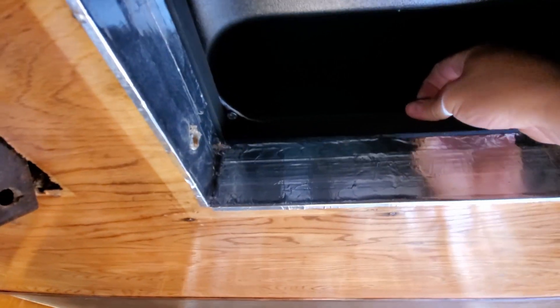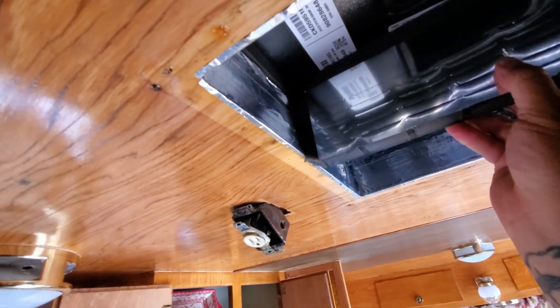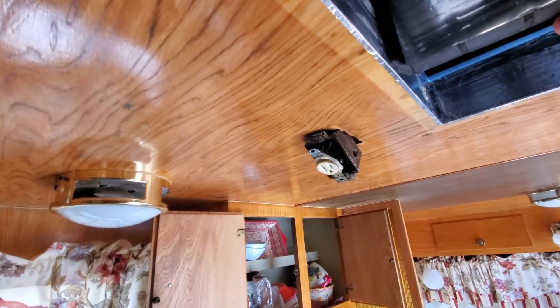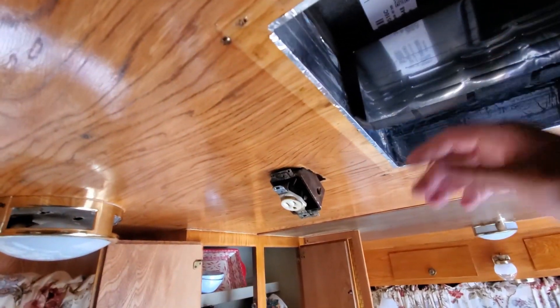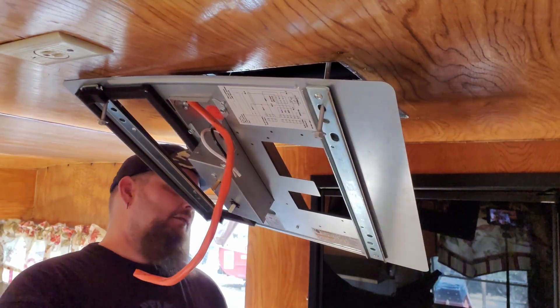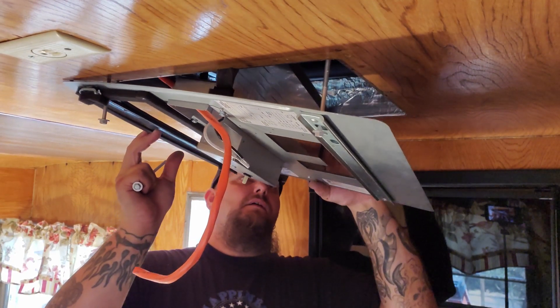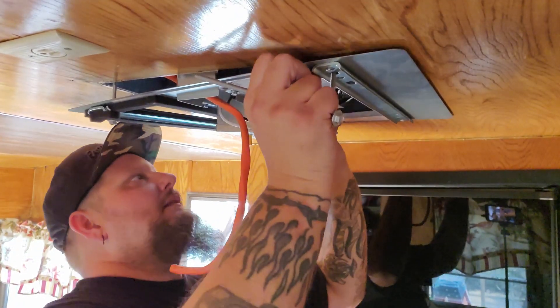After it's up there, you can move it a little bit side to side to get it all lined up so the seals are even all the way around. Next step is the duct dividers — I had to trim a little bit off, but this piece fits up in here. It's got a seal and you want it to be pretty flush with the bottom. When I press it up and hold the AC down, I'm right at the bottom. There's a seal inside the cover that pushes on this. Got the cable run through and I'm getting ready to put the duct divider in.